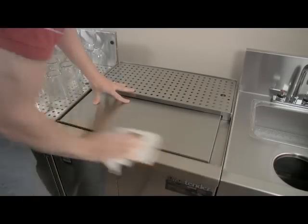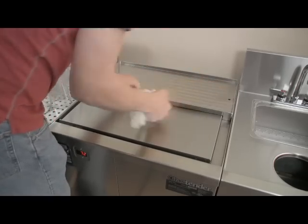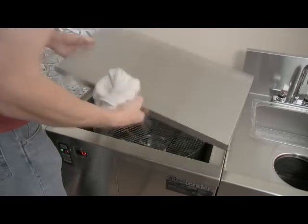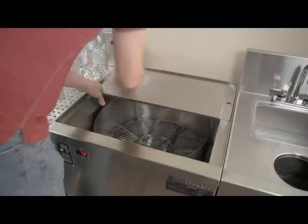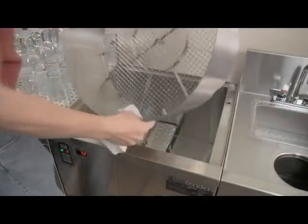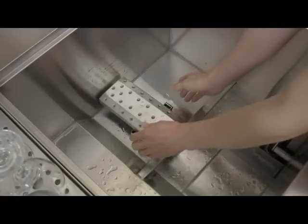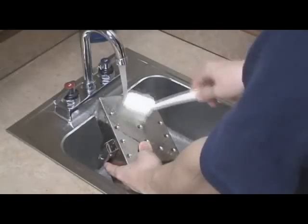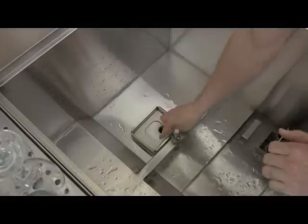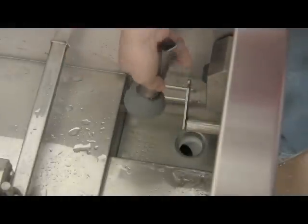At the end of each day, the GW24 glass washer should be thoroughly cleaned. The cleaning process is simple and does not involve any tools. Remove the drain board insert, drain board pan, sliding cover, and inner cover, and wipe down each part with a clean, damp cloth. Remove the conveyor wheel and rinse and wipe it down. Remove any large debris found inside the machine, such as broken glass, lemon seeds, or stir sticks. Remove and scrub the spray box with a nylon brush, making sure all spray holes are clear. Remove and clean the spray box gasket and tank screen. Remove and wipe down the drain stopper. Remove any debris from the lower wash tank, making sure nothing is clogging the pump inlet screen. The pump inlet screen can also be removed for cleaning if necessary.